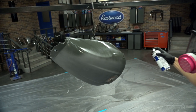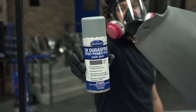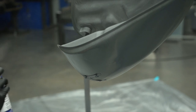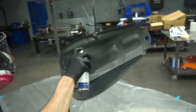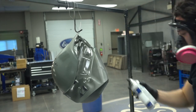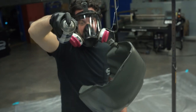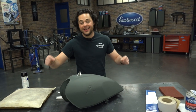We like to lay down a layer of epoxy primer before filler — it's going to protect that bare metal, and once you scuff it up the filler will adhere to it no problem. Today we're using the 2K DuraSpray cans; they come in a bunch of different formulas and we are using the epoxy primer. One of the reasons I love these cans is because it's a two-component paint, so it gives you that durability and finish like a paint gun would. More importantly, it's activated by humidity in the air — you shake it up, give it a spray, it activates in the air, hardens on your part, and then you can put the can back on the shelf and pick it up a month from now and still use the rest of the paint. When you're doing this, we always recommend a crosshatch pattern: go through the whole tank in one direction, then come back for that second coat in the opposite direction. Do it like that and you'll get really nice even coverage.